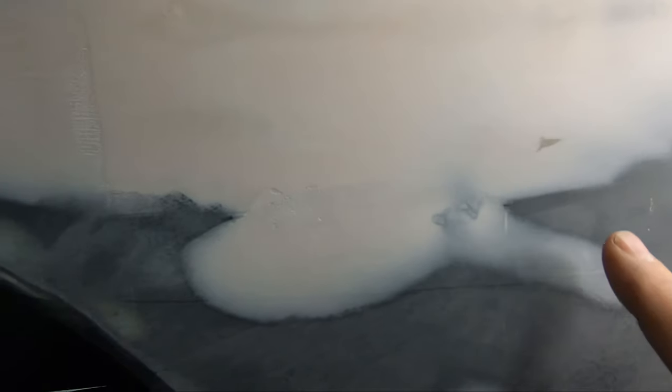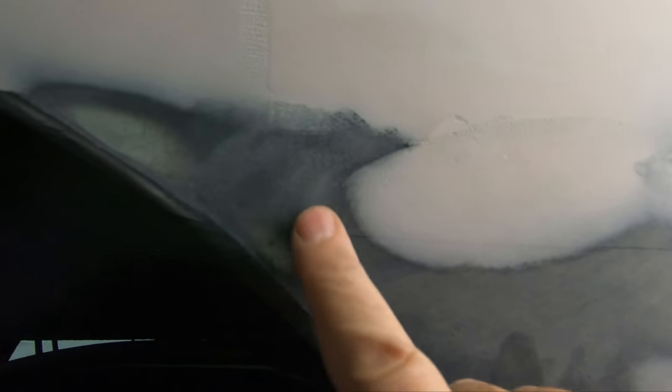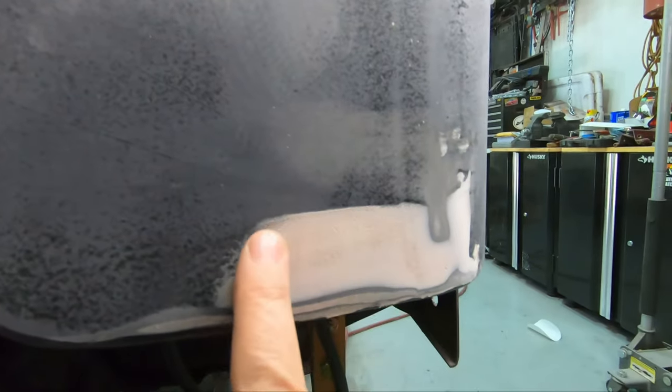What we do in drywall is you always come up, so you're sanding down your high spot. I didn't get that done here. Also, you can see any place that your edge is nice and irregular like that, you feathered it out nicely. Any place that you have a spot, you can see one here, you can see one here, where the dark is dark and the line is pretty straight, that is not a good line. You're not done there, because when that light shines down that, you're gonna see a line there. You can see another example of it here.